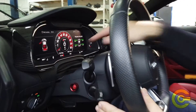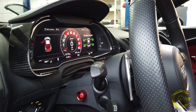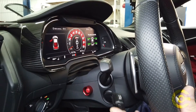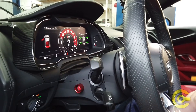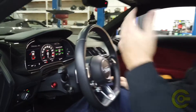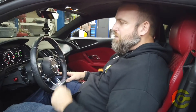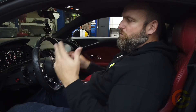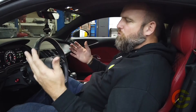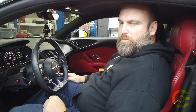The power goes up progressively from there. Press and hold and scale all the way up — map nine is the top map. In this particular build, that is 1,300 horsepower for this customer. The power goes down progressively all the way down to map one, which is the wastegate spring — roughly 800 horsepower.